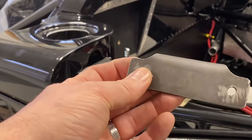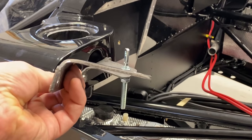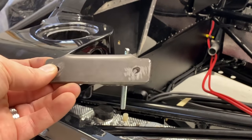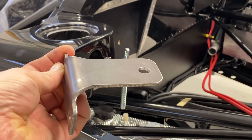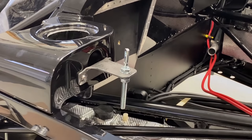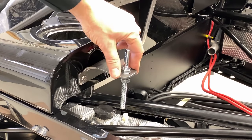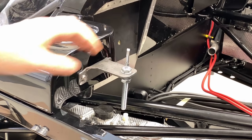And all I did to bend these, just put it in the vise and used a hammer. I don't have a sheet metal brake that's stout enough to bend. This is 10 gauge steel, and it's super rigid. In fact, with it in the car, what you see give is actually the fiberglass here,